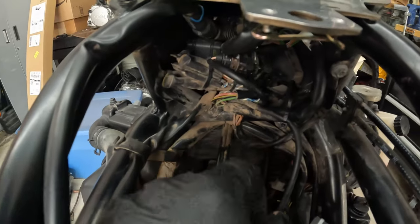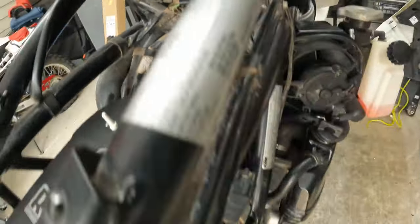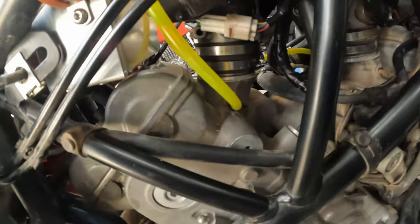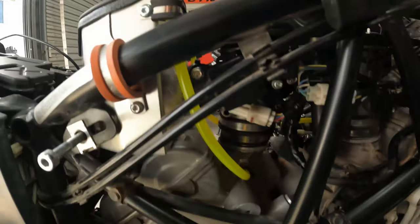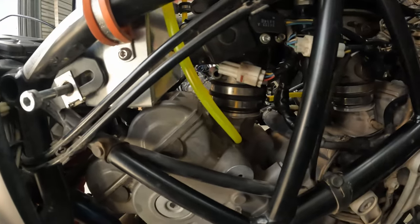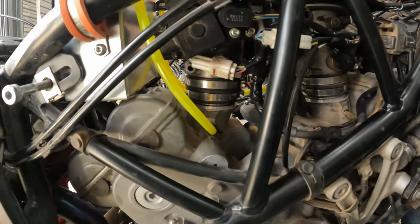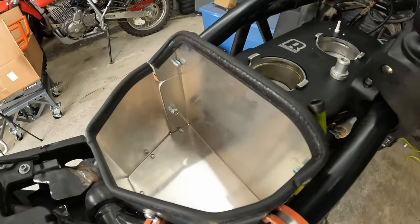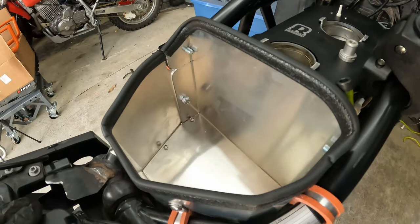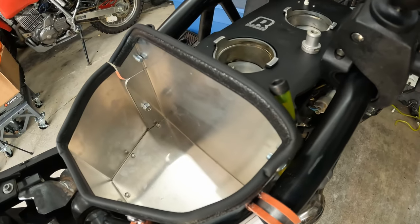Just to recap: we removed the canister from the left side of the gas tank and rerouted the gas airflow to the bottom of the skid plate. We removed the sensor and capped it with a dongle. We did a Stage 3 modification where we can balance the throttle body at any time — if you're doing Stage 2, you would leave the T and just cap it at the T. We hooked it up to the doghouse storage and Stage 3 is complete. Thanks for watching!